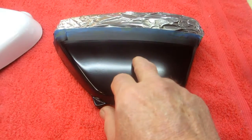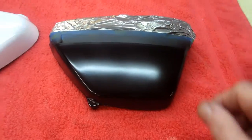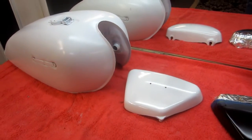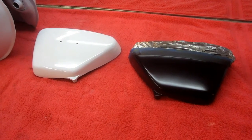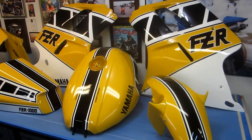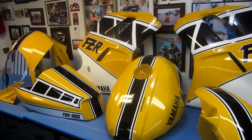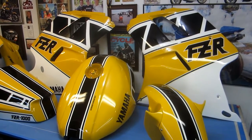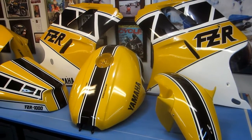And I guarantee you, if I painted this with a real spray gun, which would have ingested more thinner into it, this whole thing would have been an alligator. So, anyway, we tried our best, and sometimes you win on this, and when you're doing paints, always do the test. Such an inexpensive insurance policy. One of the problems, I don't have any white left over from my job. In fact, at the end, I was really skimping and drooling around with it. So we're going to have to get a can of white, that's for sure, automotive white, or some other scenario.